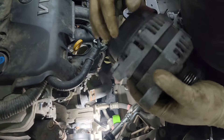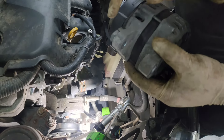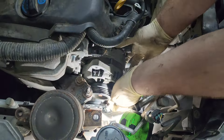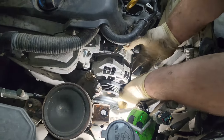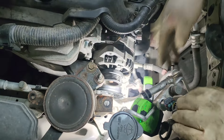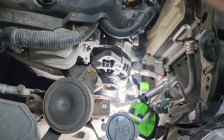Now we're going to go back in with our alternator. I had the spacer — I put the bolt in and knocked the spacer back out. I brace it on the backside here because if you don't, you can snap the ear of the alternator off. With the engine raised up, we didn't have to take that bracket loose because that gives us the distance for the bolt. We'll put our upper bracket on and leave that loose.